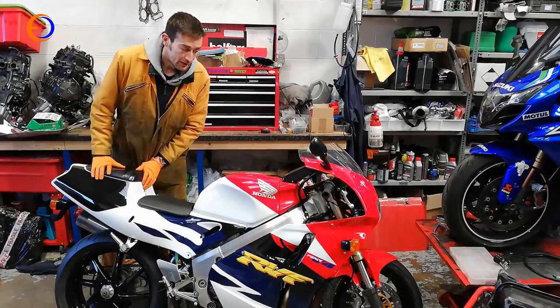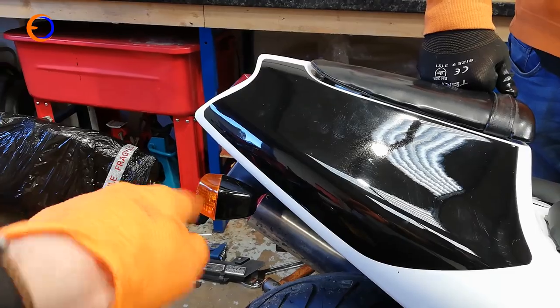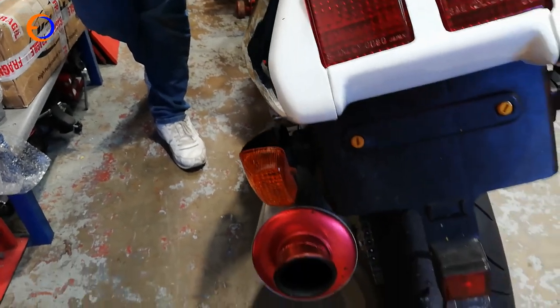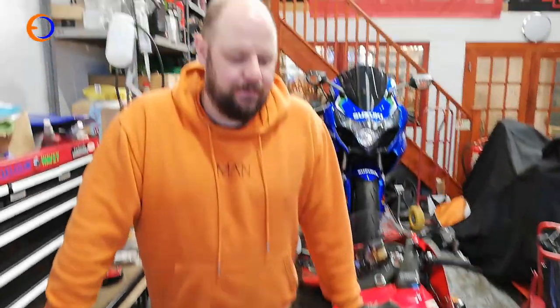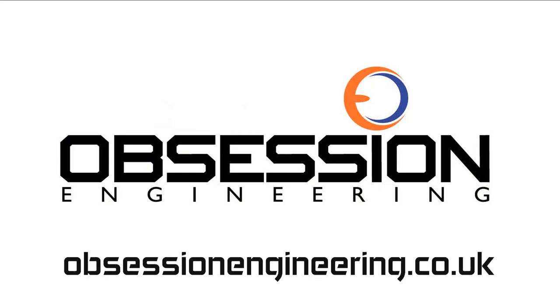Front and rear suspension are both set to a pretty good starting point. Now that we have suspension set up and a bike that actually runs, it comes down to finer details before the MOT: number plate not attached yet, bar end plugs needed, Paul at A16A is making a new silencer. The old exhaust has been straightened — used a piece of big pole and pulled the pipework a bit straighter. Next stage is the MOT. Thanks for watching — join us next time when we get the RVF on the road.